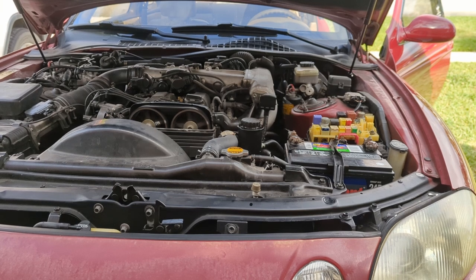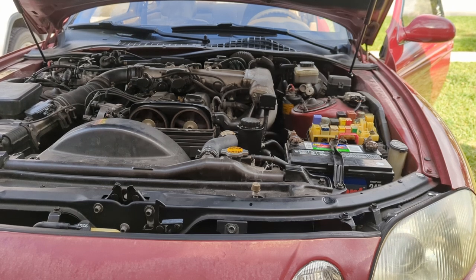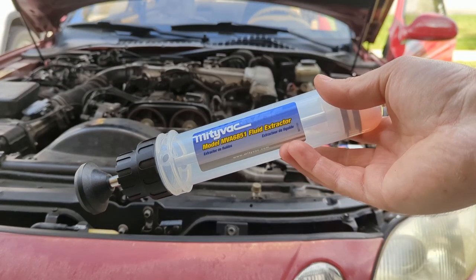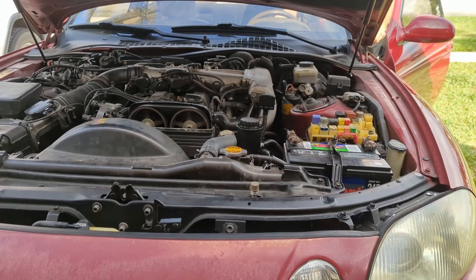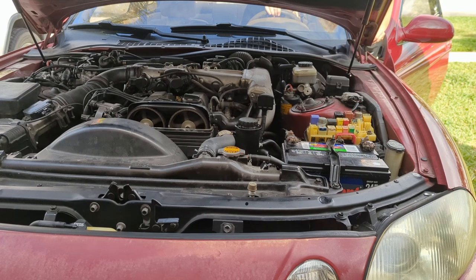I was able to get the power steering pump to quiet down considerably by simply changing the fluid. I don't know who put what in there, but the pump says it should take automatic transmission fluid, and whatever was in there was not automatic transmission fluid. It was very clear and kind of low viscosity, so I sucked it out with this bad boy. I'll leave a link in the description. And I dumped in some Dexron 3, so I'm just going to do that again. Turn the steering wheel back and forth a couple of times just to circulate the fluid around and dilute whatever was in there.